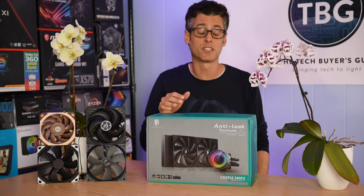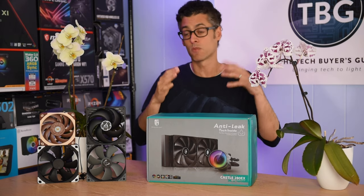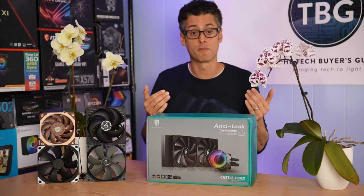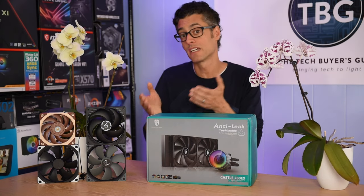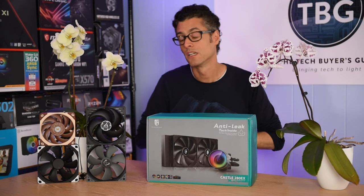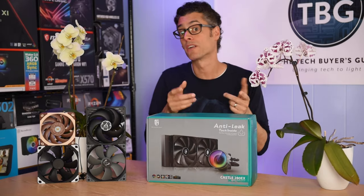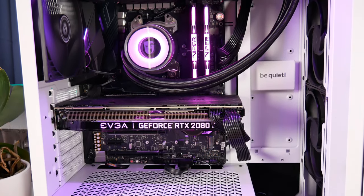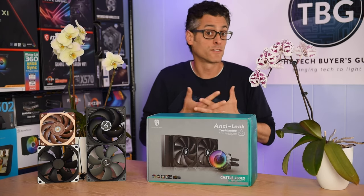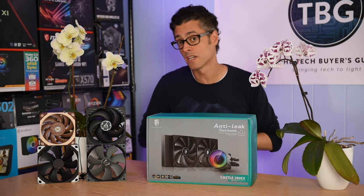That means for just about everyone, I recommend you mount it up top if you can. But in my upcoming video where I equip this cooler with aftermarket fans, I'm actually going to mount it up front — because all I will care about when testing the fans is CPU temps, and as I've shown, CPU temps are best when mounted up front. Furthermore, it's much easier for me to switch out fans and give you audio samples if the fans are in front rather than buried up top inside the chassis. I also want to commend BeQuiet for designing a great mid-sized ATX chassis that can actually fit a 280mm all-in-one up top. I've said a few things that were pretty controversial in this video — if you have comments or questions, please post them down below. If you enjoyed the video, I do appreciate a like and subscribe, and I will catch you next time.